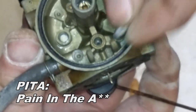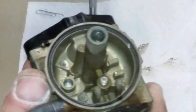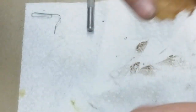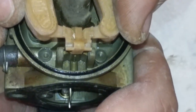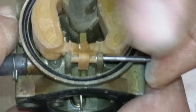There are plenty of pain points when working on a small engine, and this is one of them. The float valve needle needs to go into the float valve bore; however, you can't assemble it in that order because then the float itself can't engage the needle. You need to put the needle into the float first, and then while it's dangling, assemble it - getting the needle down into the bore without it falling out. This one wasn't too bad. It's the diaphragm pump type carbs on a chainsaw or weed whipper with a rocker arm on the needle - those are the ones that really get the curse words flying.